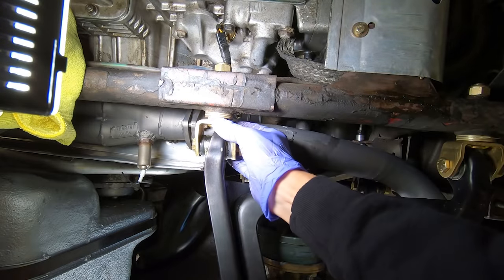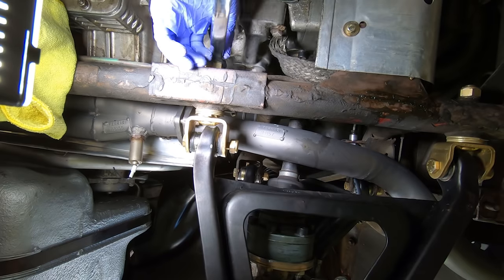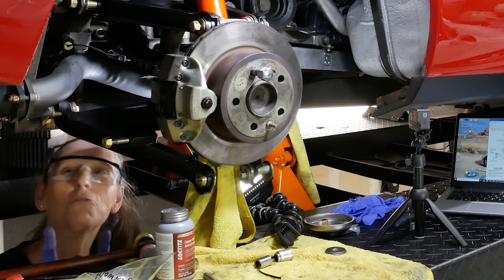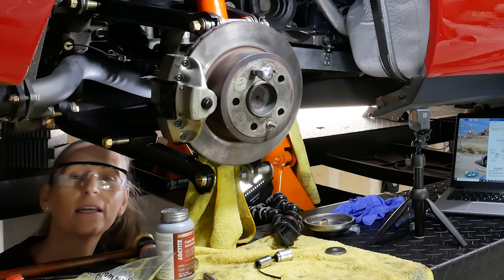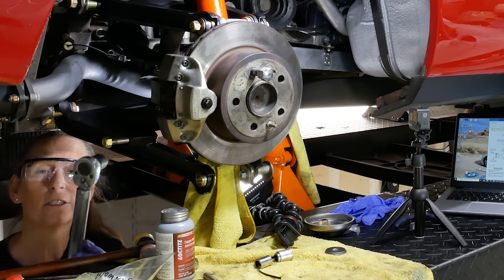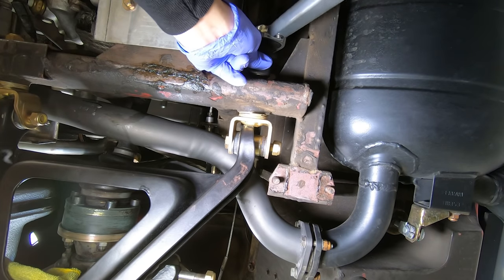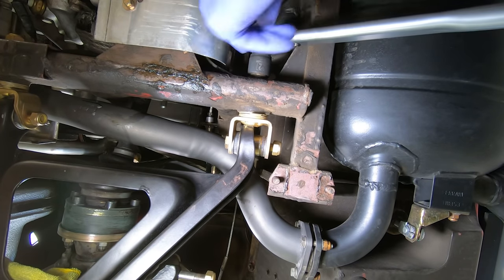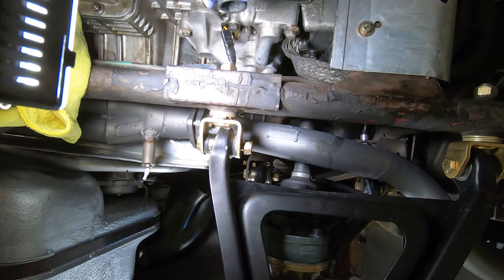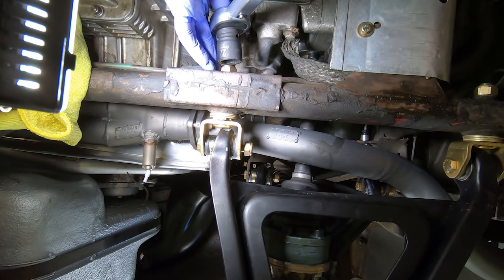Okay, that's all of them in. Holy cow, that's a lot. The torque for these huge bolts here is 8 kilogram meters, or about 58 foot-pounds. I've got my torque wrench all set here. Let's go ahead and nip these up. There we go. And this one down here, because I can't get this over this. It's so close, but I just can't.